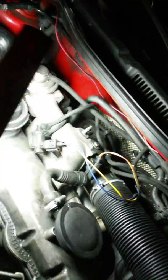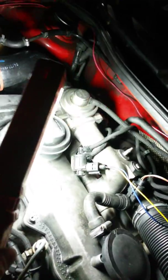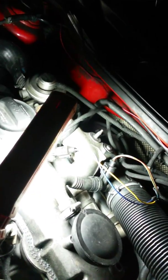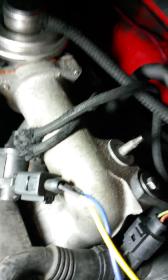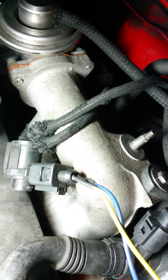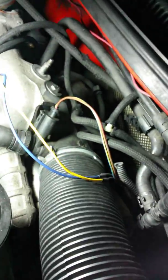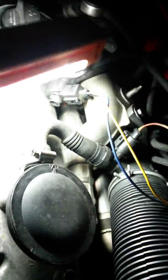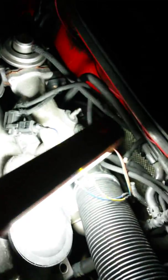What they should have done from the factory — because you can see they put all these other solenoids up on the firewall — this was just a bad design! This solenoid shouldn't have been on the intake; it should have been on the firewall, reducing the amount of vibration going to that wire. These wires have been replaced — I trimmed them down into the socket, about an inch out from the socket, hooked up new wires, heat shrunk them. I advise everybody with one of these ALH engines: get this solenoid off the intake manifold and zip-tie it up onto this line here.